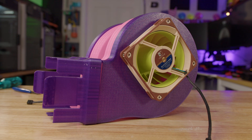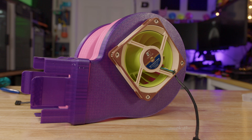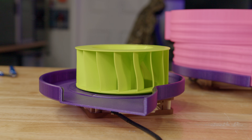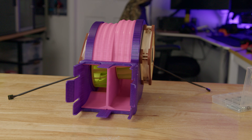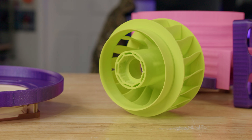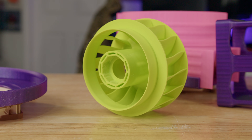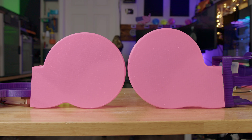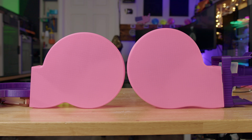Given noise is a weighted metric in Season 7 and he's using a blower fan, Q knew he'd need to employ techniques to combat noise. He went for a large rotor diameter with a quite deep rotor to reduce rotational speed and maintain airflow. He also made sure there are no cutoffs or weird interferences around the rotor that might create turbulence. The blades are swept backwards — something common in blower and squirrel cage fans — which helps reduce noise. The intake tunnel from the rotor to the cooler is quite long, designed to promote laminar flow.